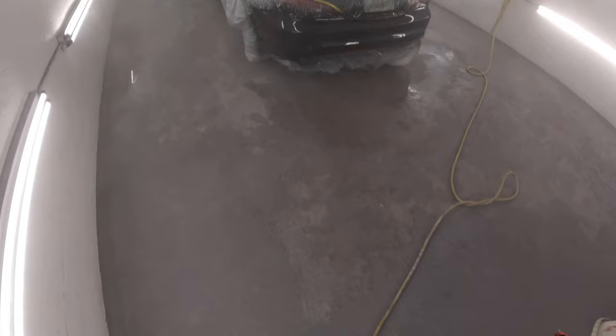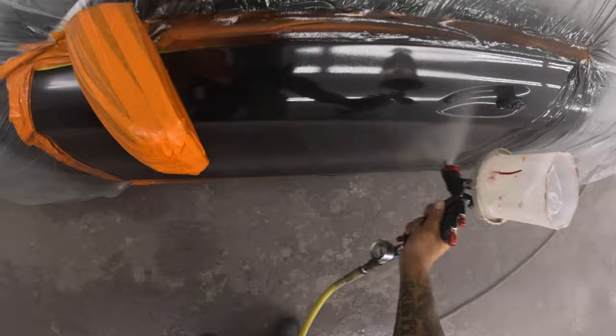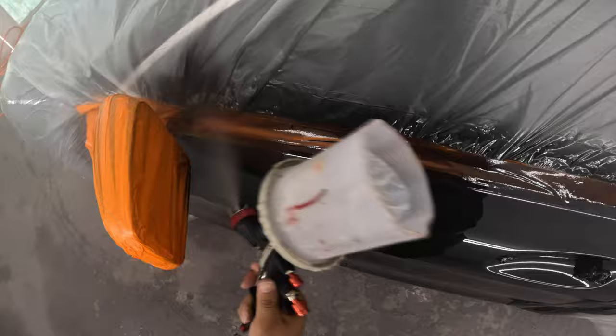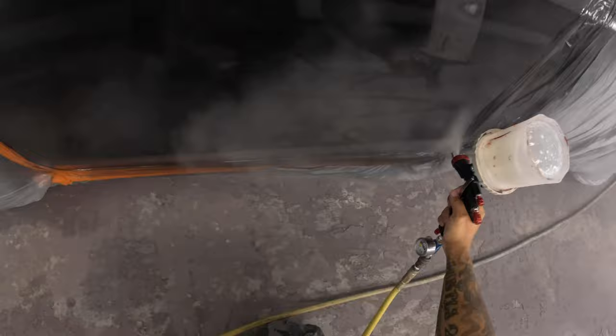And also with that little motor guard, that filter on there, like no water was coming out of there. Usually when I use this little compressor, that's for my projects around my house, nail gun. One time I changed my flooring, I put a chipper on there and chip out concrete, stuff like that. But I would always get water coming out. So no water was coming out of that paint gun at all with that little setup, with that motor guard thingy there. So that was pretty cool. I always had to use those little filters that you put before the gun. They look orange and blue, little water separator things. But that worked, man. It worked like a charm. But yeah, finishing up here.